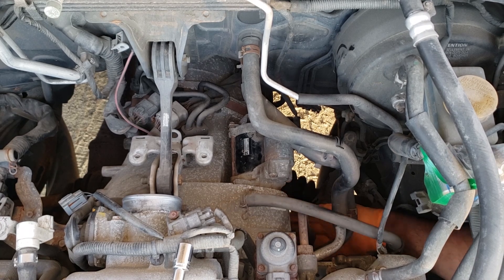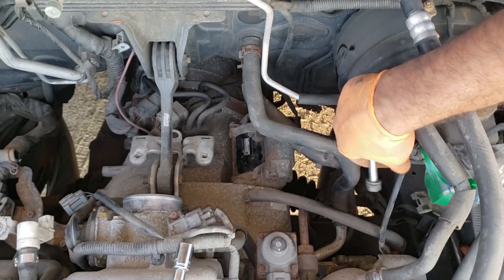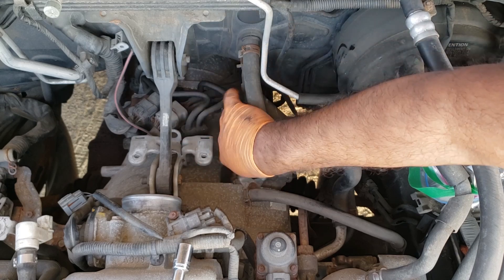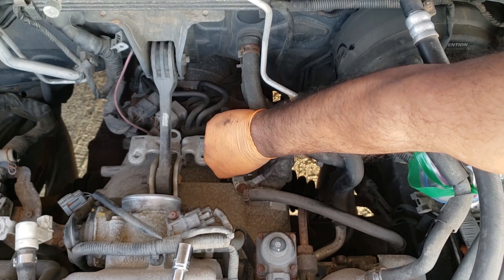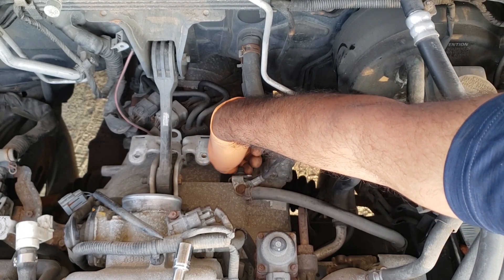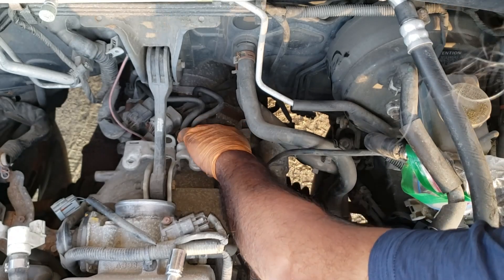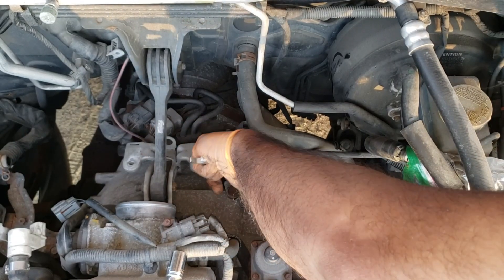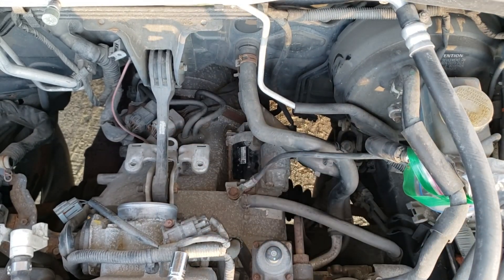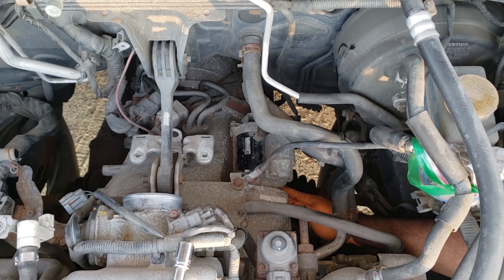There we go. Don't forget — there is a washer on the nut. The washer is important, don't lose it. Just make sure as you're backing it out, you hold onto it with your thumb or whatever finger you can get on it. Put that in a safe place. Now you can generally force the starter out by hand, but this being the rust belt, let's get a pry bar. About 17-18 inches should do it. There we go — starter's out.